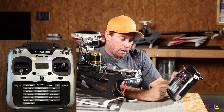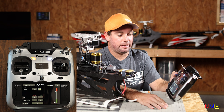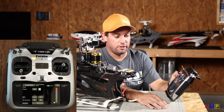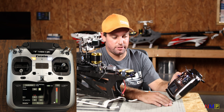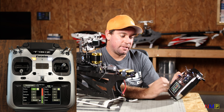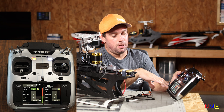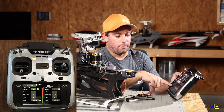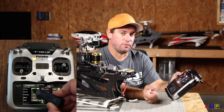Acceleration — this is what's commonly called pitch pump. If you want your pitch to have a boost when you move it, you can set a rate for high and for low, so it can apply to just positive or just negative pitch. You can set them symmetrically or differently. For electric helicopters, I tend to just manage it the way I described with throttle curves. For nitro, you can activate throttle hold here and assign it to a switch — this controls throttle in that condition rather than just using the throttle curve.